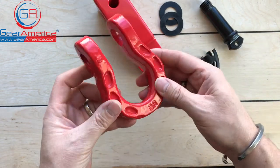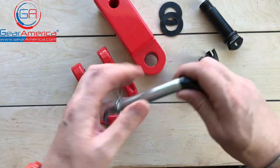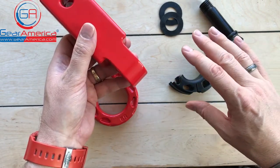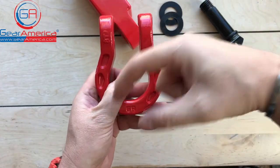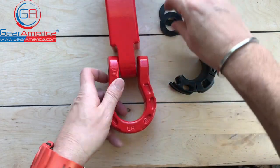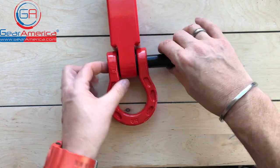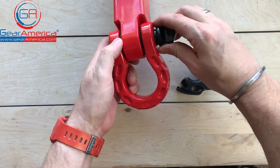This unit is great for people that don't have shackle mounts or tow points on a vehicle but have a two-inch receiver, because you can put this in your two-inch receiver, use the supplied five-eighths inch pin, and with that eight-ton capacity use this as a closed loop system — which everybody knows is the safest way to recover a vehicle. By closed loop I mean you have your shackle with a pin through it, with a tow strap through that — everything's closed, you don't have any hooks or anything that can break free or come loose. Not only do you have the safest possible way to recover a vehicle, but you're also using the safest part of the vehicle in the tow hitch receiver because that's what it's designed for — towing. It's already built heavy duty, tied into the frame, and it's a great way to recover stuck vehicles.